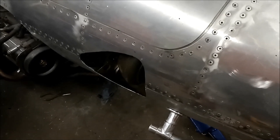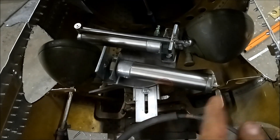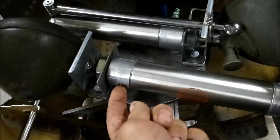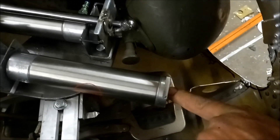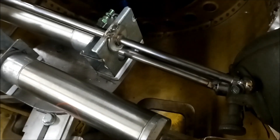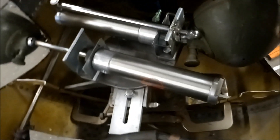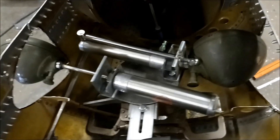Here's the inside setup — I made an arch-shaped base and there's an adjustable slide. These are air cylinders and I'll be putting engine vacuum on a vacuum switch. There's another hole in the end so I can suck them closed or suck them open, and they basically slide out like that. This one is scrubbing a bit because I need to put a guiding prop rod in so it clears and slides perfectly — just a little sticky, needs some oil. That's how the headlights are going to work and I'm pretty impressed with that little maneuver.